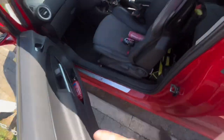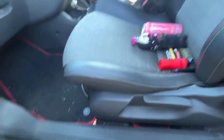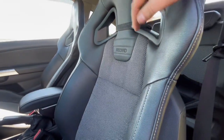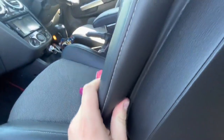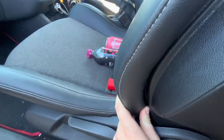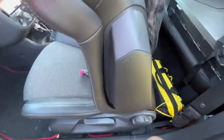More interior stuff here — I haven't done anything to the side step panels yet, but I love them so I'm not going to mess with them. Obviously, I've got the Recaro buckets. They need a little bit of a clean. A common problem with these buckets is the clip bit — you can see I managed to push that in. That should stay in at all times, so I think I need either some new seat clips, or to pull the seats out and put them in properly. Also, when I first had the car, I broke the release mechanism under here. I fixed it now — pulled it back into place. However, when you pull the seat forward, normally the seat should tip forward once released, but it doesn't do that anymore.